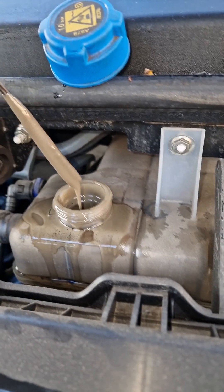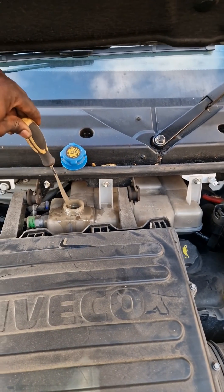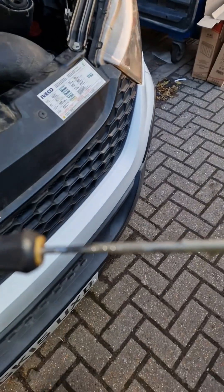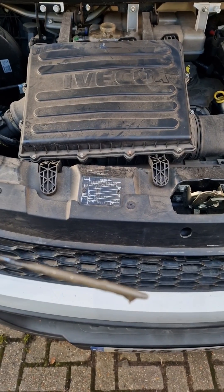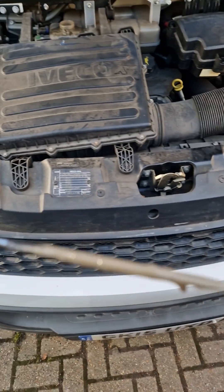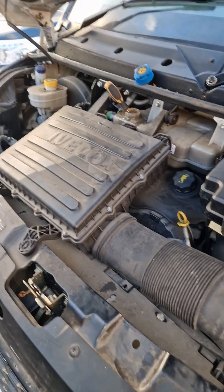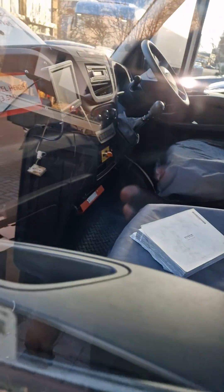What would you change first? That's absolutely crazy. It doesn't look like anyone put oil in it properly - sort of put it directly in there. You never really know these days, but it doesn't look like it. It's in some sort of spinach-like state. This is oil mixing in the cooler, so I would say it's going to be the oil cooler - there's a good chance it could be. And if not that, then we can look at a gasket. If there's anything else, let me know.